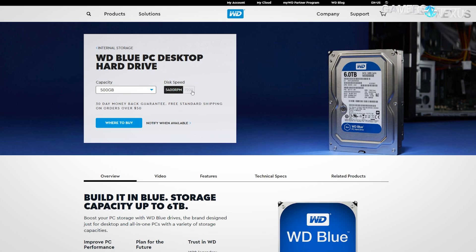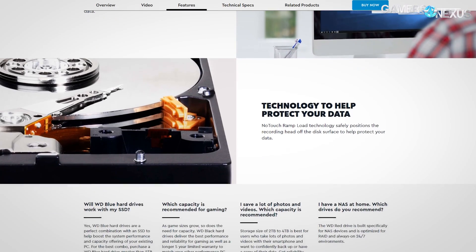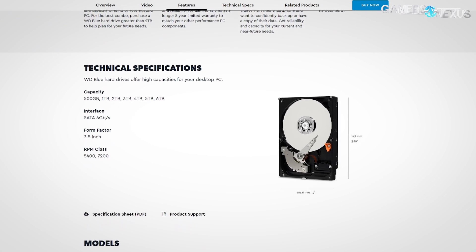There's technically a 500GB capacity, but those are being phased out because the platter density doesn't make much sense for 500GB these days. WD Blue at 7200 RPM is what we'd recommend for most game storage or higher-density media like RAW files, but you'll need to be sure you're not accidentally buying a 5400 RPM variant because they exist in several capacities. The 1TB WD Blue at 7200 RPM is the go-to for gaming storage — we'd recommend archiving your games there rather than a 5400 RPM drive. The Blue drives really only lack a few features: vibration protection, and time-limited error recovery, or TLER, which is also not found on WD Blue. If that's something you specifically want, don't buy a Blue.